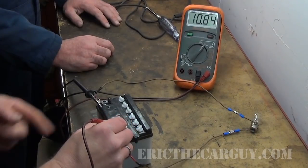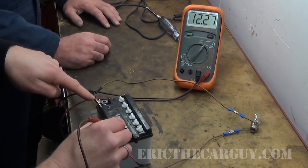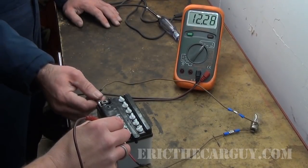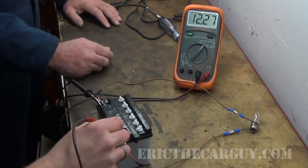Your meter is never an issue — you've been using it for the past 20 years. The issue is you're checking that ground. So when I come over here and check this positive and read 12 volts on my meter, I'm checking that ground. You saw that voltage change a little bit there — connections are so important with electricity. If you've got any kind of corrosion or the connection isn't solid, all of your testing is going to be off because you're not going to have accurate readings. You're losing before you've even begun if you didn't make sure you have a good ground on your meter.